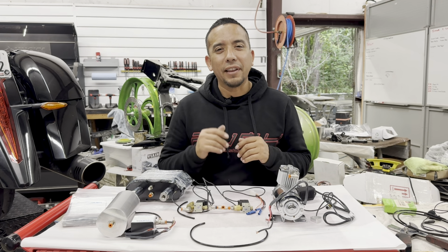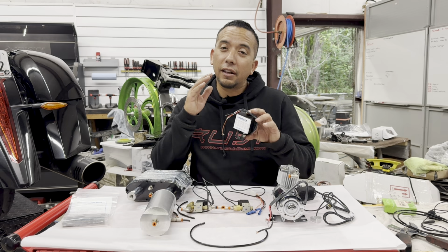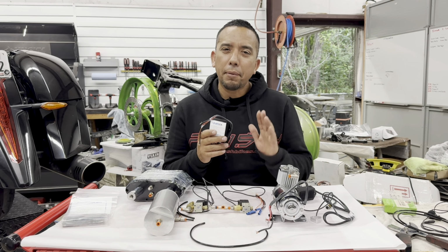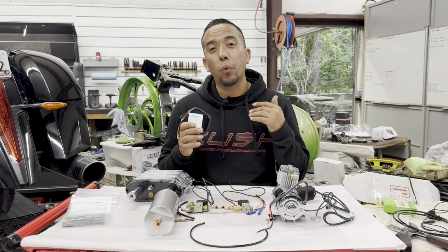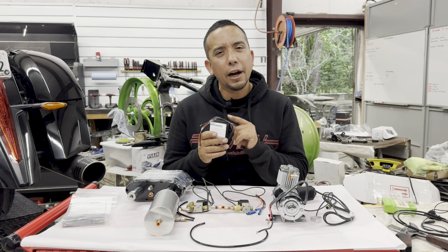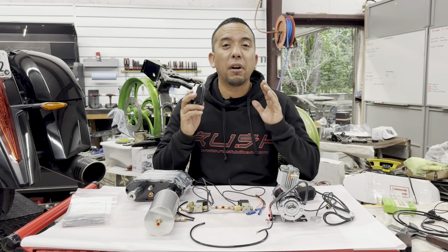Now let's talk about the Instant Up air pressure switch. Now this is brand new on the market in the lineup of AirFX products. Most of the air switches that you see stop at about 100 to 150 PSI, which is fine, but with the Softails it allows a lot more pressure in order to raise the bike. So AirFX came out with a 250 PSI air pressure switch for your system, and these are amazing. They make the bike go up a lot faster.